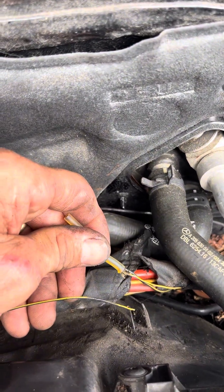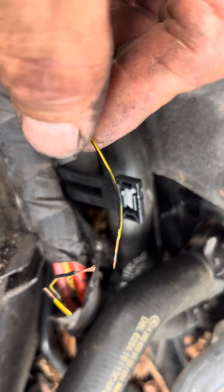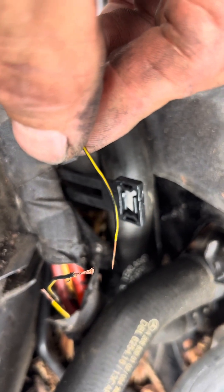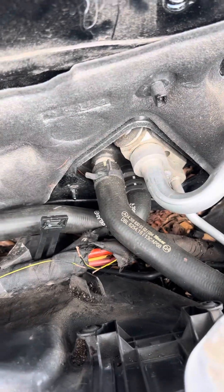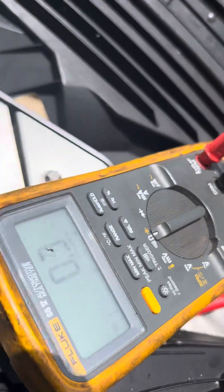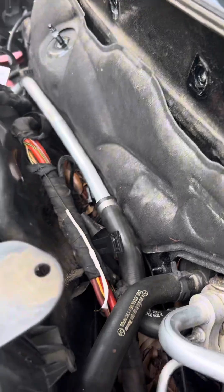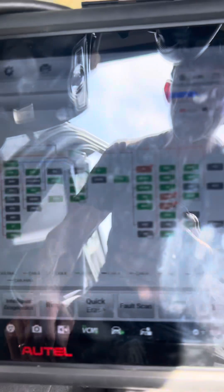I'm going to fix this and let's see what it does. You can see the corrosion on these wires — see the discoloration. Dielectric grease, heat shrink, and I'll clean this up and recheck my work. I'm going to heat shrink that together. From one side to the other — we're good. There's my wire repair. Everything checked out. Powertrain control unit — everything checked out for me.